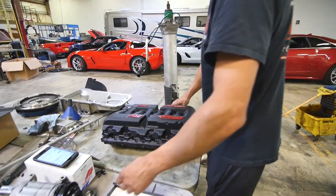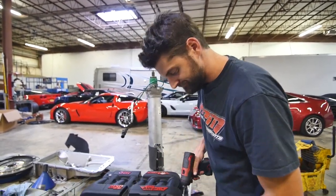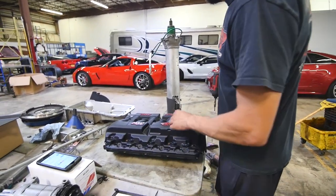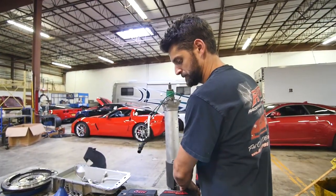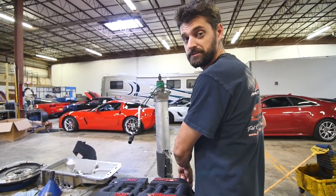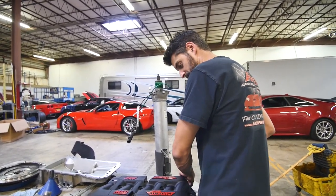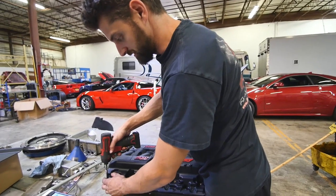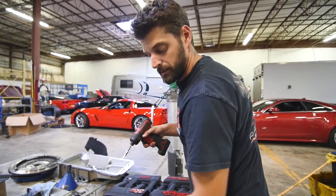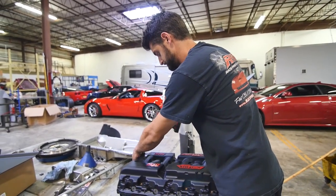Can I help you? I mean, if you would like to. Do I know what I'm doing? I mean, I know what you're doing, but I would like you to tell the viewers what you're doing. I'm preparing this Mamo ported MSD intake manifold for installation. What do you mean, they don't come ready for installation? They do not. What do you have to do, Matthew? Unfortunately, you have to select one of three map sensor ports and drill it out.